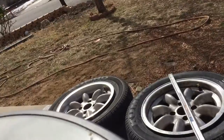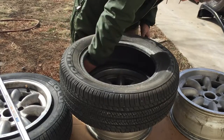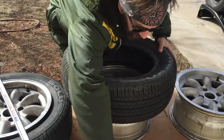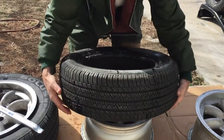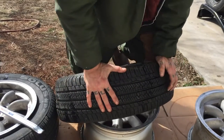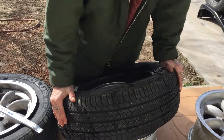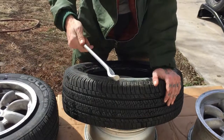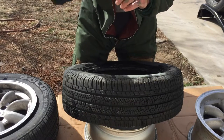For all the people that want to claim that mounting tires is so hard, I'm going to show you how I do it. A little bit of soapy water — take the tire, make sure there's no splits in it, soap the water onto the edge of both sides. Then I just kind of get two knees down and do it nice and tight. You want at least half of the tire, half of the rim, through. These tire irons are more for breaking a bead — I can show that in another video. Comment below if you want to see how to break a bead with just two of these.